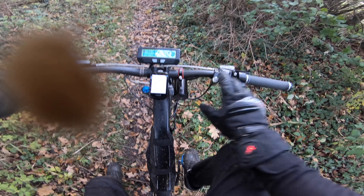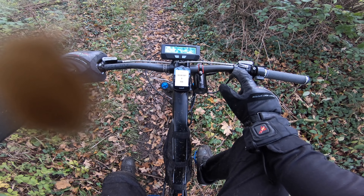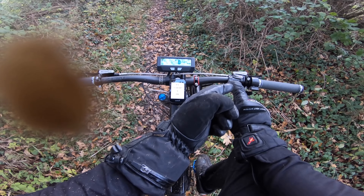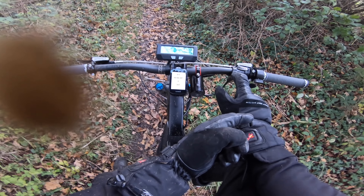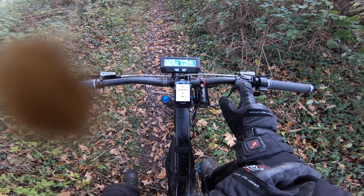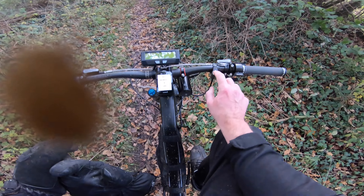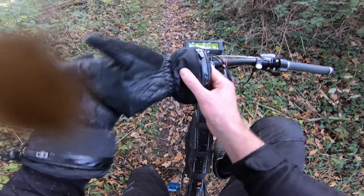First little problem here — we've hit some sort of phase over current or something. I'm going to be really straight up with you guys and tell you exactly all the problems and little issues that you will face if you do this sort of thing. I'm going to shut down. This is a good thing about having the BMS plug on here, because you can effectively shut down the BMS which will restart the controller. So that's shut down — we're off to a really good start, aren't we guys. I'm going to fire it back up again.